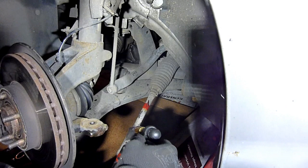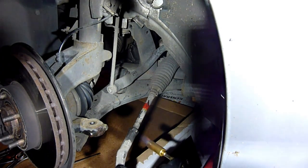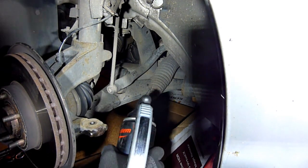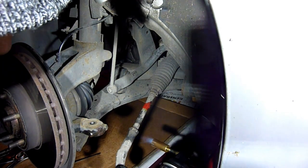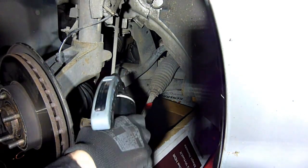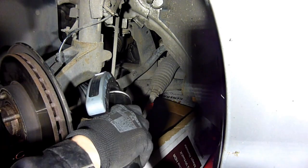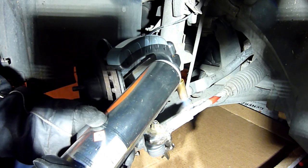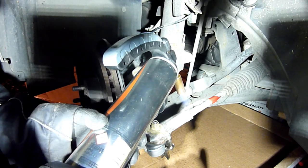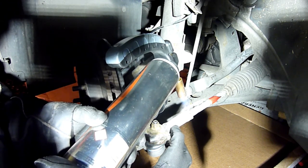You can see it's not too hot — otherwise it'll start melting the ball joint. This is not the best gas torch I've got — this is what someone like Scotty Kilmer recommends. I don't have a proper blow torch but this is as close as I've got. He always swears by this. I'll keep my hand on there and make sure I don't get it too hot. Obviously if it were red hot — but I'll never get it red hot with butane; you'd need acetylene for that kind of thing.